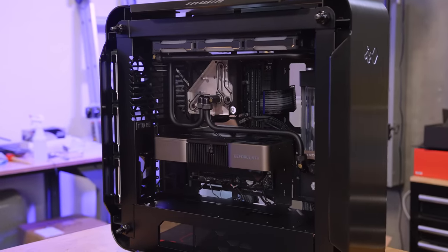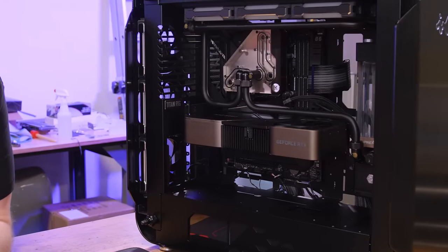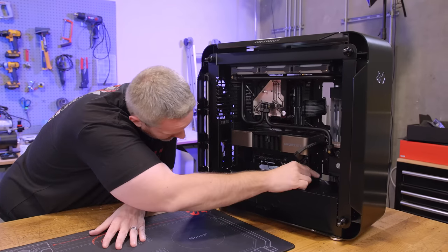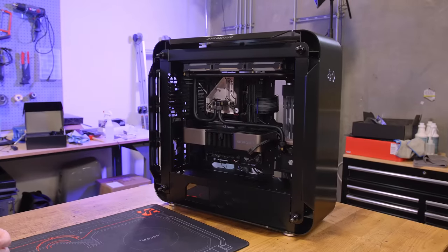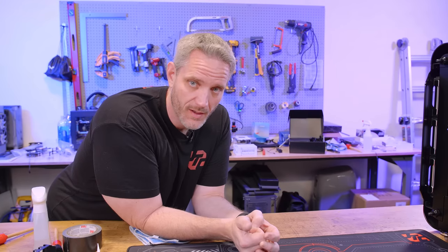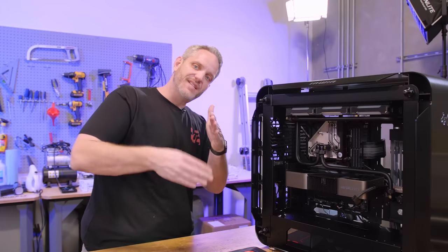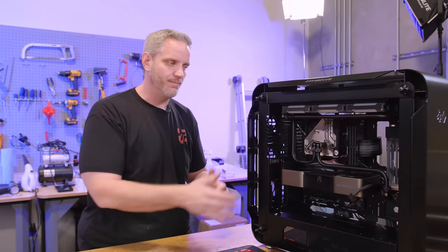It really looks empty now. It needs another one — it needs two. The issue is this area right here is too empty and I can see all that wiring and see through, which I normally couldn't. I would have to build myself like a little shroud or something that covers that area out of styrene painted black, which wouldn't be hard. But it only gets into the mid-60s under gaming with overclocks up, with a much more aggressive fan curve than stock. What I noticed is I can't turn this fan up as high as I want because it's so close to parts of the motherboard tray — it makes a weird sound because of the fan going past stuff. It makes a weird high-pitched kind of sound that you don't hear when the cooler is not against that piece right there.